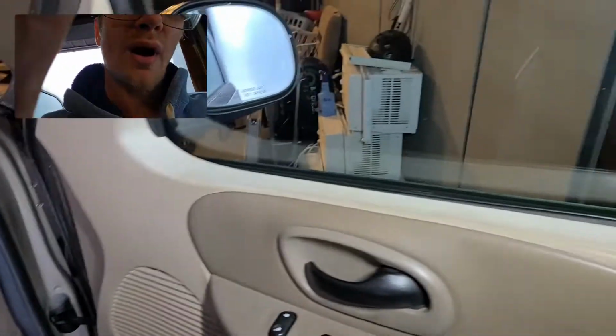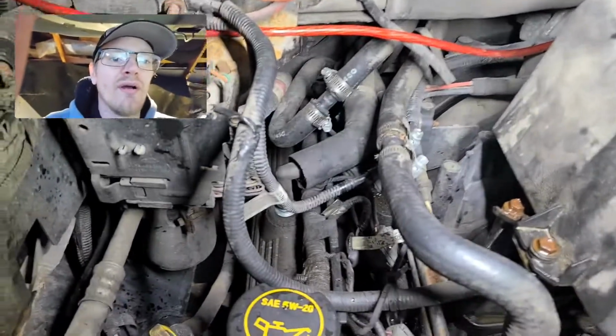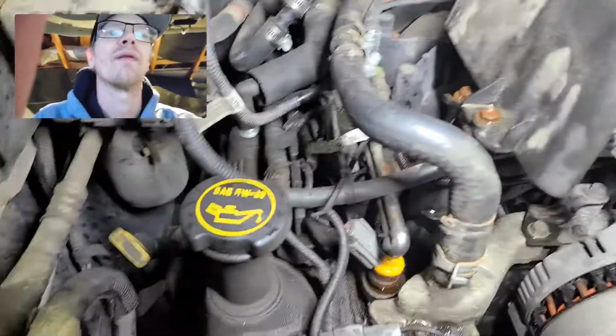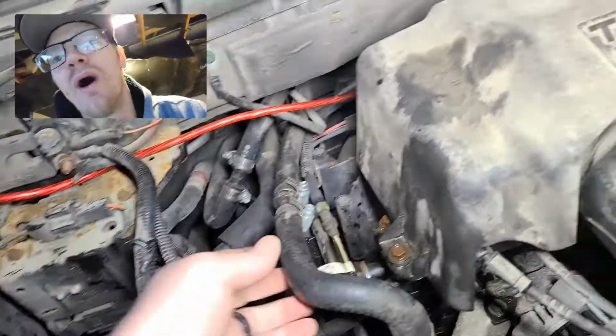So now what? Now we got to go back out and do some burping procedures. That felt warm when I looked at it, but not super hot, you know? And I don't think it was like a 160 or whatever the opening on the T-stat is here. So now we're coming back to burping procedures back here, and this is not my specialty, but I am probably going to create some kind of a device that raises this up, and I can bleed and purge the air out of the system. Why Ford hasn't made something like this, I don't know why.